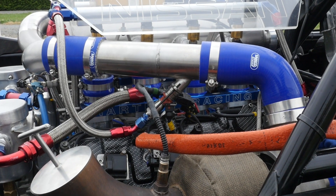There are a couple of injectors fitted into the turbo compressor outlet, and these are used when the engine comes on boost — they inject a fine atomised mist of methanol fuel into the hot intake air. The latent heat of evaporation of methanol is very high, which means as it's injected in, it absorbs heat out of the air as it goes through a phase change from liquid into vapour. This actually cools down that hot intake air, which is why we don't need intercoolers.